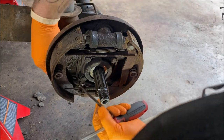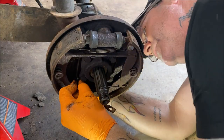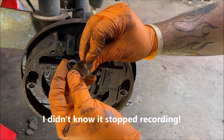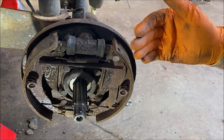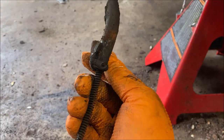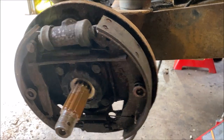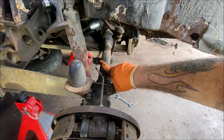This clip was a pain — usually they're not that bad, I guess it's just been on here so long. I'll remove the other side now. On this side, the whole bracket came out, which was convenient — it slid right out through the hole. It just fought me on the other side, but things like that are going to happen. Handbrake cables are disconnected. On the axle tube there's a clamp holding the brake line so it doesn't flop around — I'm going to go ahead and pull that clip off.